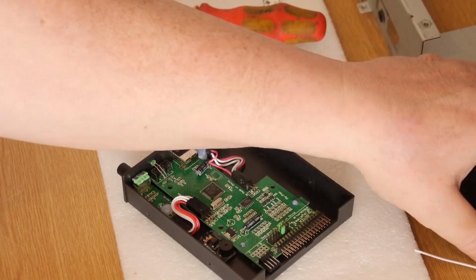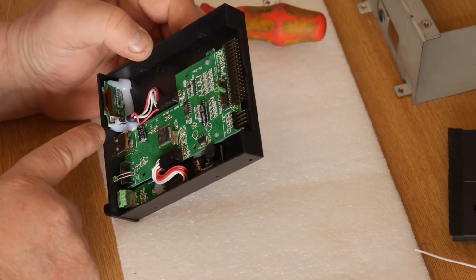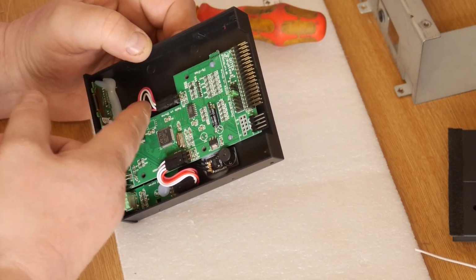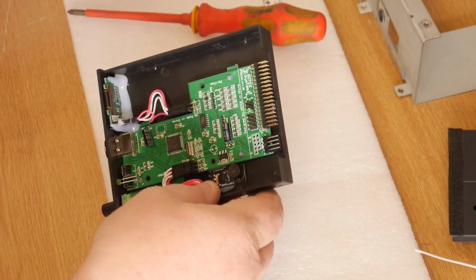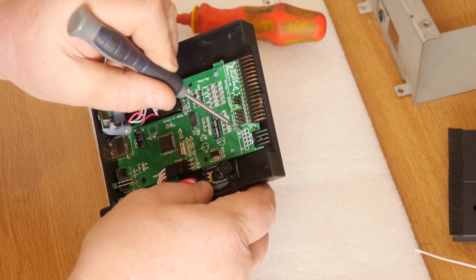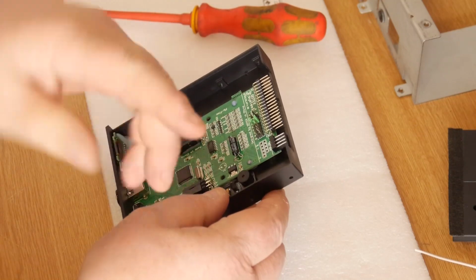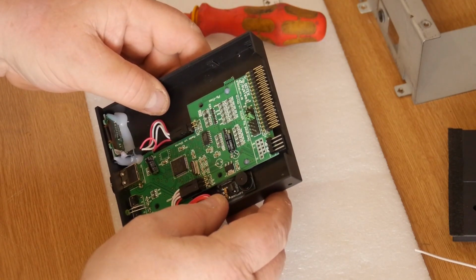So as you peel it open, what you'll see in here is your cables to your display, which are already there. It's your original display. You'll see pins here for your display driver. And down here on this bank, this very furthest one, right there, is a reset. So what we need to do is solder a wire for a reset into there as well. And then basically all we're doing is paralleling these back out to the new display that we've created. So let's crack on with that.